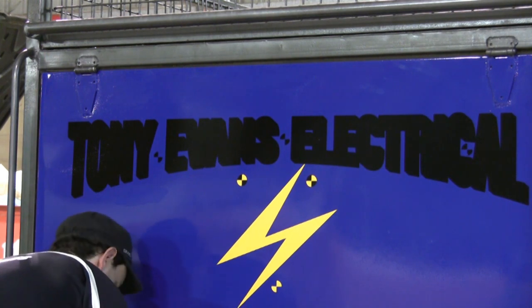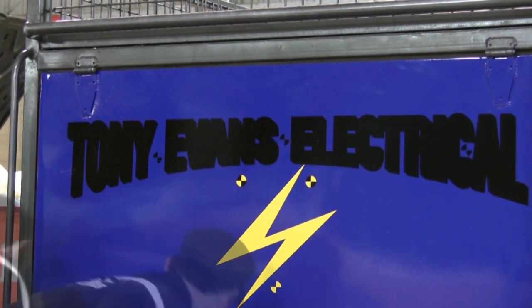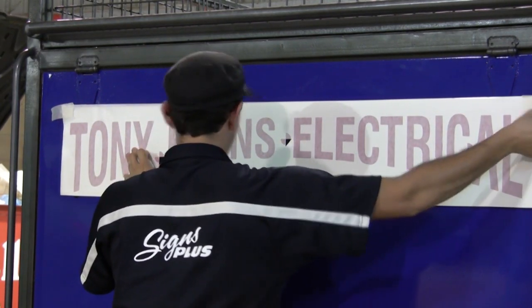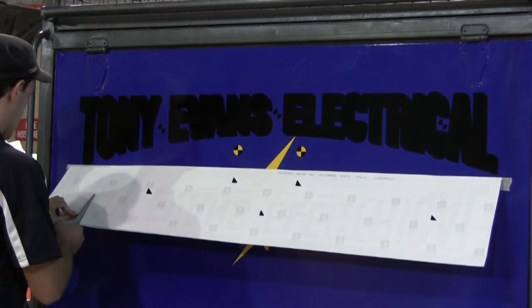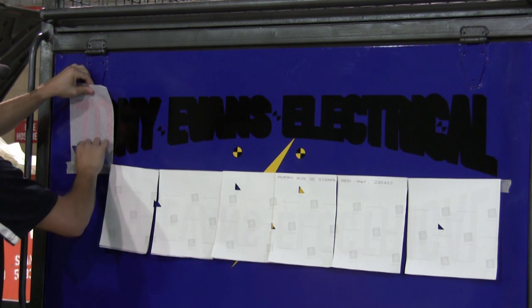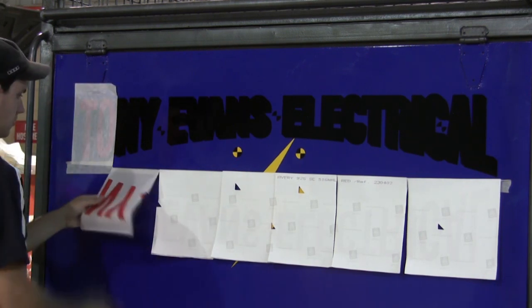Now we line up our next color using the lineup guides again. We've pre-cut some small holes — taking a sector out of those lineup guides — so you can easily see the lineup guide that was put on with the first layer of vinyl. Line that up to within half a millimeter or even better; you can get extremely good accuracy with this method. We'll do a bottom hinge method on this one and cut the decal up into manageable sections. Doing it in sections rather than one big decal makes the job a lot easier — it's very easy for one person to do and quite quick.